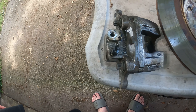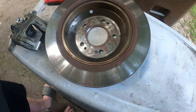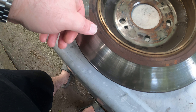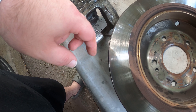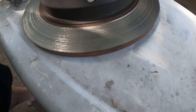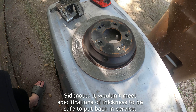All right guys, got it torn down so I'll give you a little view of the carnage. This old caliper — she's done. I know I could probably rebuild it, but I'll probably strip all the bolts off it and toss it. If I ever change the calipers on this car again it won't be factory — it'll be the Brembos from the Genesis Coupe. What's odd is it seized from the back, but the front is smooth — it has a lip on the outside.